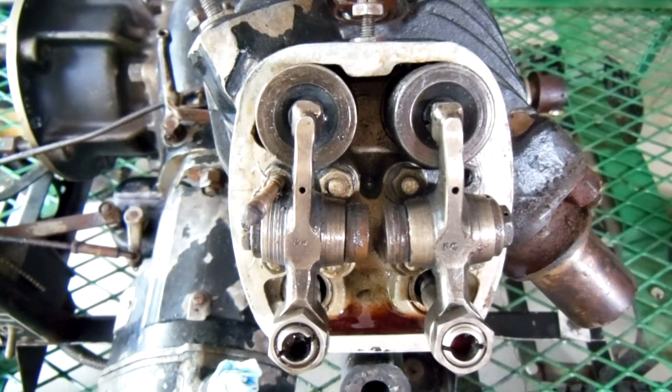What we would do on a radial engine — staking a valve — can also be applied to this engine if you're experiencing blow-by. However, on this particular engine, considering how long it's sat outside, we're probably dealing with some very fine surface rust on the valve face, and in fact, looking down through the spark plug hole when the valve is fully open, I can actually see just that.